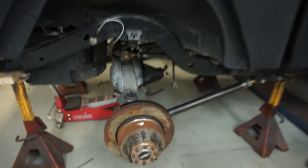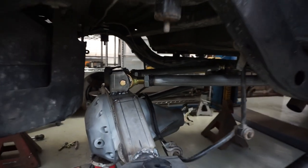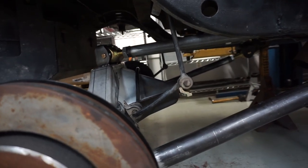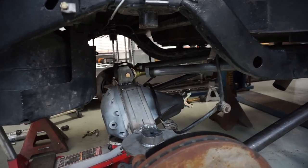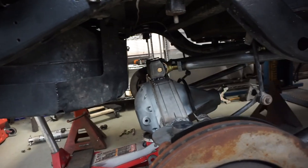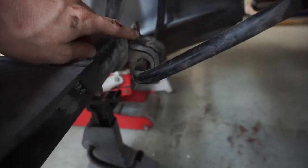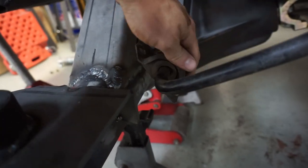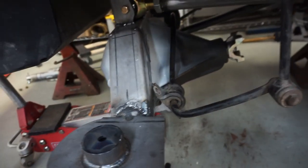We are all finished with the rear. It's in temporarily because we have to get it painted, but it's in — the arms are done. It looks really good and it's really clean. Everything is welded on and in place. There are no go-backs or do-overs except for these because I'm not happy with them. All we have left is figuring out the sway bar. Eventually I'll go to an aftermarket, but for now we're running the stock one from my TJ. We're just going to make some brackets for it out of some square tubing — cut it in half and make a seat-looking piece with bolt holes.